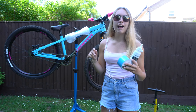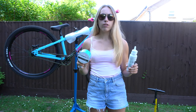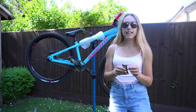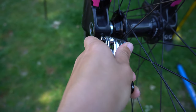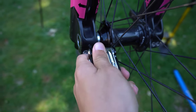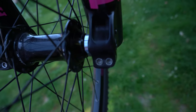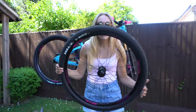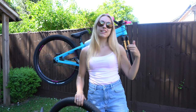What I'm going to do first is check what tire pressures are in each wheel because I literally cannot remember how much air is in the tires. Same as before, just got to take the wheels out and take the tubes out. These forks are a little bit different because they are not quick release - they've got little bolts on the back which you have to undo, and then you put an allen key through there and the wheel will drop out.